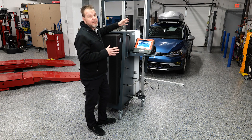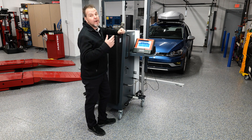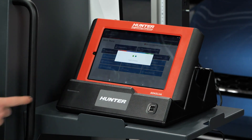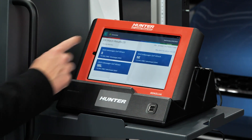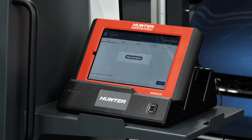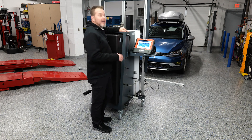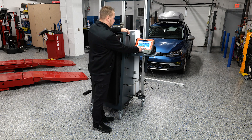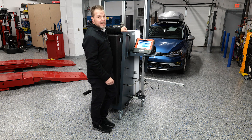We've got our VCI hooked up to our DLC already. We're going to go ahead and do our diagnostics and begin the calibration procedure of our front radar. Select diagnostics — we're going to auto-ID the VIN. This is a Volkswagen Golf Alltrack S; I did look that up to verify. So we select that, and it's asking us to cycle the ignition. We're in our diagnostic screen. We have a host of options here, but we are going to go to ADAS calibration, starred at the bottom. We have two choices: camera or front facing radar.